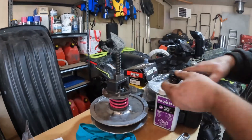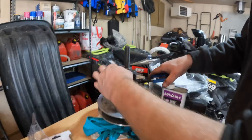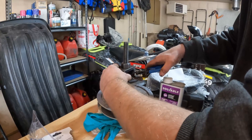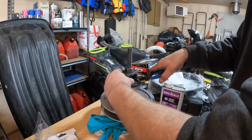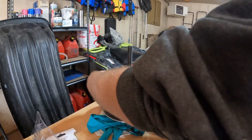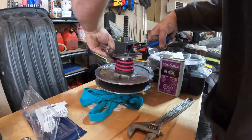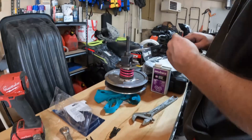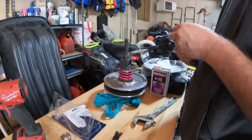Just to clarify, if you go with the EPI clutch performance, your white ring will be for top speed — to help get more top speed, about five kilometers more an hour. While the pink one — the one we're putting on — it's for torque. So if you're in the mud most of the time or drag racing, this is the one you want.